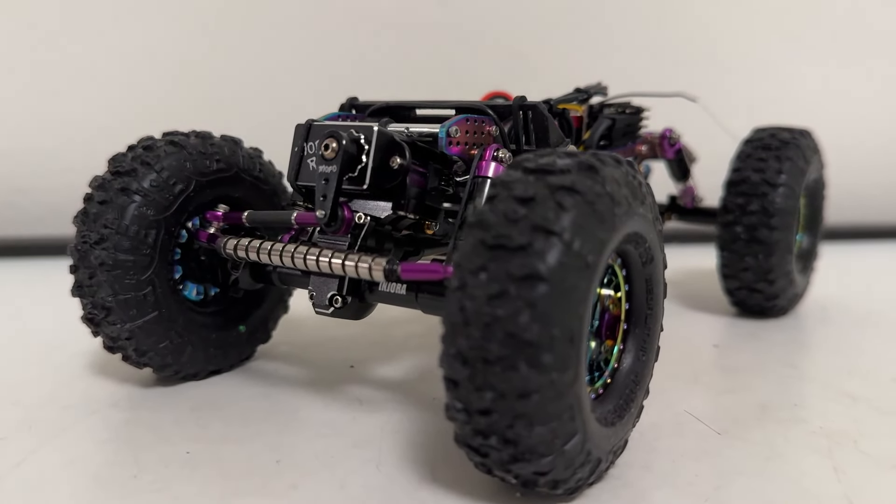Initially I had their KTEC flat skid on the bottom in teal, but in mocking this up I had some issues with the lower links and clearance. These are Maz Designs titanium links — you can see they've got a high offset pivot head. With the lowers and the uppers in the same plane, you can see how extreme that angle is, so there was a collision with the flat skid. This traditional skid has the lowers dropped down, so there's no conflict with the uppers. So I lost the teal and went to purple here, but I kind of like the mix and match — it works well with the frame colors.